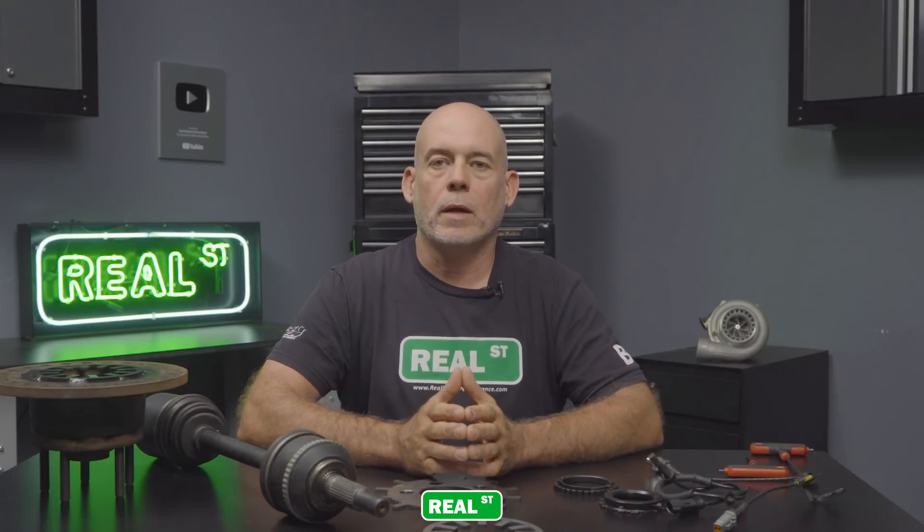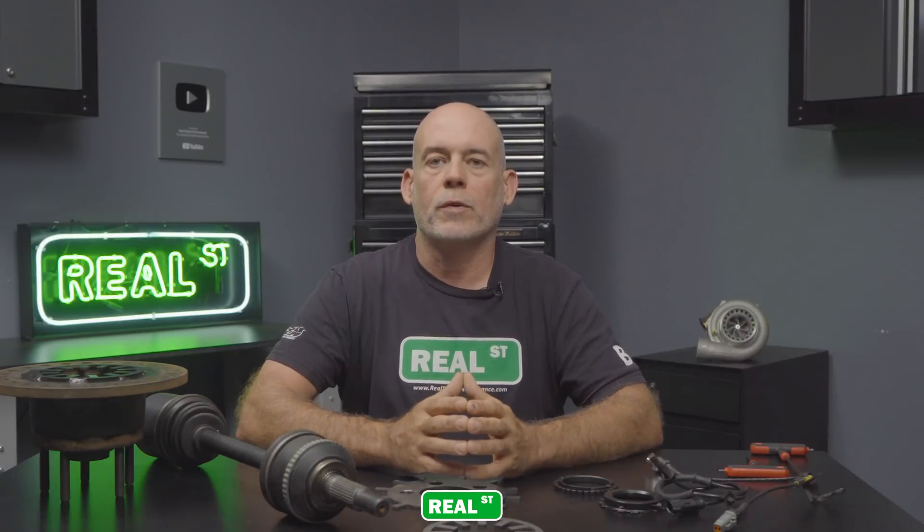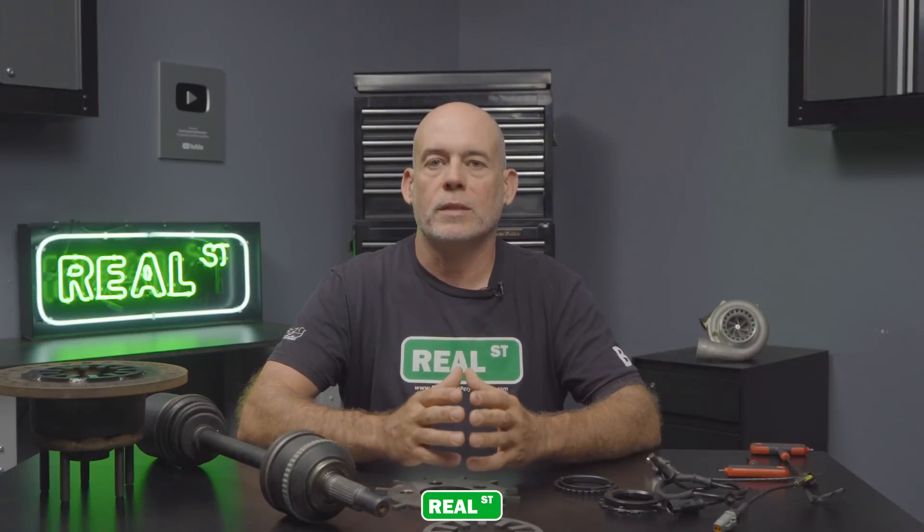The focus of this video is on two-wheel drive vehicles — vehicles that have a driven set of wheels and a non-driven set of wheels. If you have a four-wheel drive vehicle and want traction control, it's a bit more complicated and I'd like to answer those questions by email. If you're retrofitting traction control on a vehicle with an existing electronic speed input, it's important to know two things: whether that input is on a driven or non-driven wheel, and whether the tooth count offers enough resolution for precise traction control.